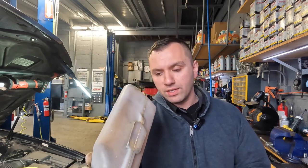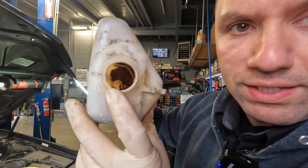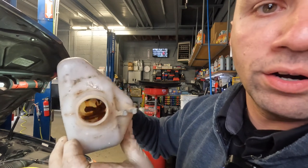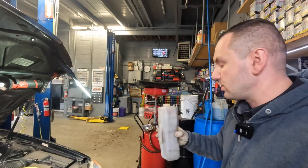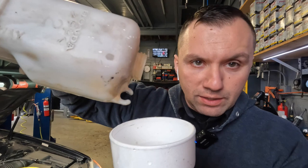While the engine is still bleeding and purging air, I went ahead and removed the reservoir. The reservoir tells a really good story of what's going on in this engine. In there you can see it looks like there's some clay buildup, with a little bit of water. I shook it to see what would happen, and the more I shake it the more you can see the mixture clean up. I'm going to pour it out and let's see what kind of nastiness we get.